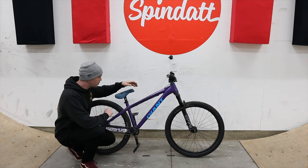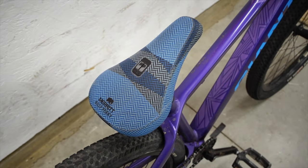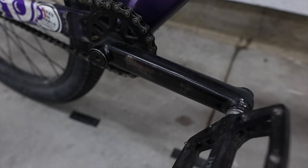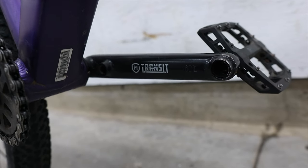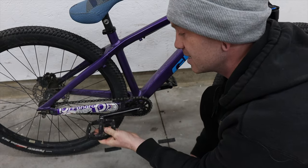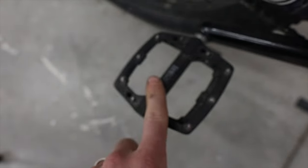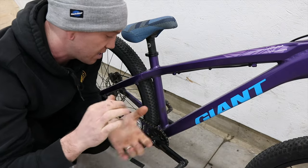The seatpost is the stock 30.9 Giant pivotal post with the best saddle on the market — the Billy Perry saddle by Merit. Drivetrain-wise, I forget exactly what brand the cranks are — they say 'Trans,' I think it's Mission Transits. They were the cheapest cranks I could find when building the GTMX and came in a relatively short length: 160 millimeters with a 25-tooth People sprocket. And some of the best pedals I've ever used — Theory plastic pedals with metal pins, about 45 bucks. Because these are a BMX crank on a mountain bike frame, I'm using an Odyssey BMX European-style thread-in bottom bracket to make it all work.